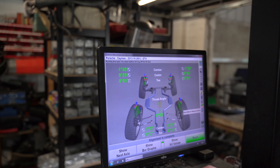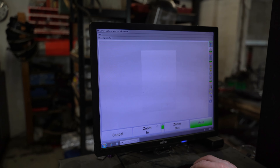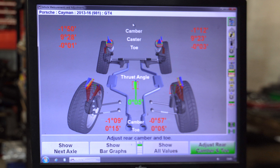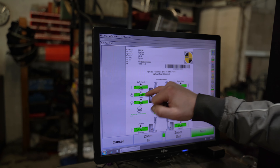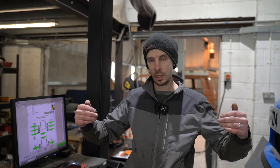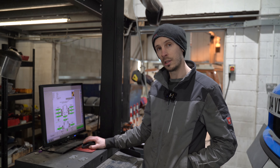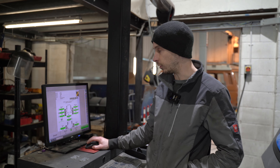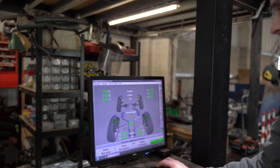When you came in, your front caster values were down at 9.28 and 9.23 — they were quite low. By adding the shims, those caster values have now come up to just under 10 degrees. As you make the front of the car wider, the diagonal arm isn't elastic, so it pulls the wheels forward. The only way you'd know the shims are there is that the front caster values are now higher than before by about half a degree.